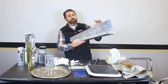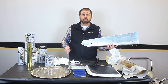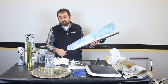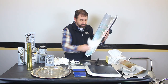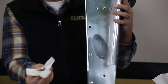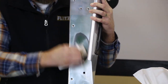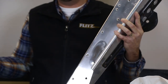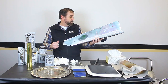Another thing I'm going to tell you about — snowmobiles. I know we were just talking about summer, but we'll go back to winter a little bit here. You've got snowmobile tunnels — they're dull, they're oxidized, they get a lot of stone chips on them, get pretty worn over time. Take a little bit of Flitz Polish, put it right on the area. Just like as we did before, buff it in and buff it right off. Instantly, you're going to start seeing that oxidation lifting off your snowmobile tunnel, and it'll bring your finish right back out to new. This is more of a high polish tunnel, but you can use it on all your tunnels. It'll help seal and protect it for the next time you're out on the trails.